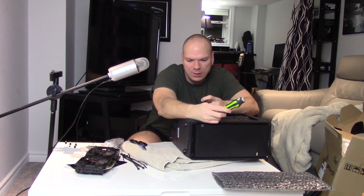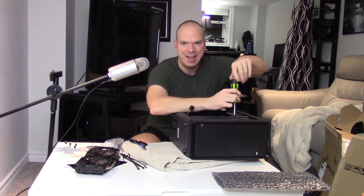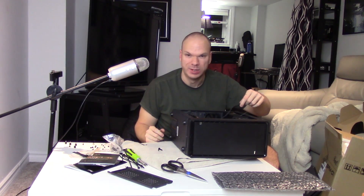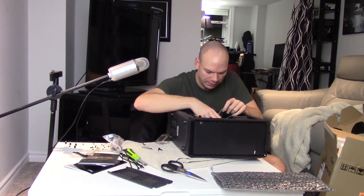I'm back with a GTX 670 — I think that's the one we'll go with. Actually, turns out we can't use the 670, or at least we could, but there's only one 6+2 pin connector on this power supply. I'd rather not use a splitter, even though going from 8-pin to two 6-pin is one of the safer configurations. So instead, let's put a GTX 970 in with a single 8-pin connector and upgrade the CPU a little to a 3470 which I have. On the plus side it fits, but I had to remove the drive slat to make it fit — that's okay, it opens up the case and we didn't need it anyway. I didn't want to use the 970 in this build, but it's my old card I got for $250 two years ago, and I have no problems getting some value out of it before it plummets entirely. Let's tie down some cables.